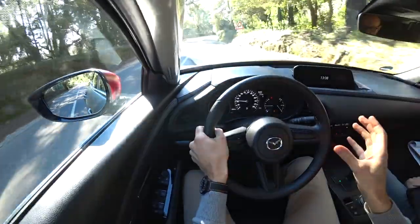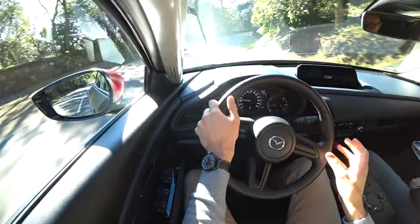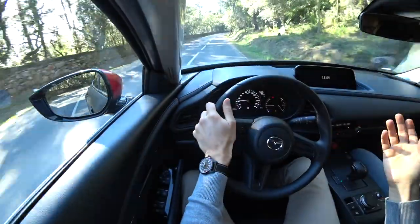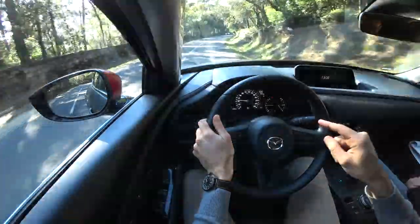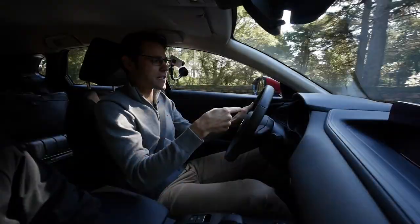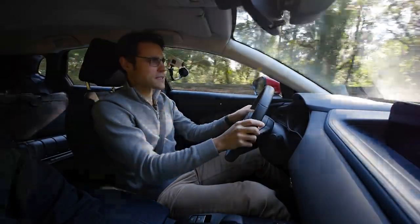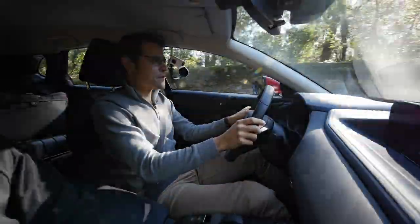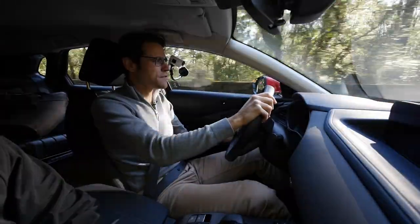And the manufacturers have different philosophies, whether they do it the one way or the other. This rolling approach is actually more efficient when you roll, but as soon as you reduce the speed, the recuperation is better, of course. But you can always induce it with the braking pedal. First the recuperation is done, and then when you need more braking power, the real brakes set in. And the first thing I feel is that it feels astonishingly normal. It doesn't feel that much EV alike.